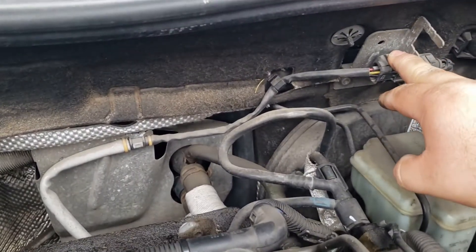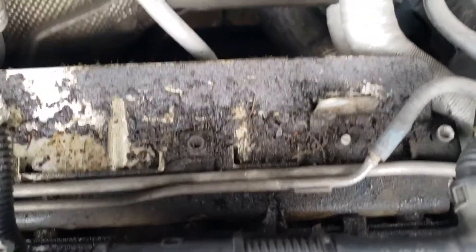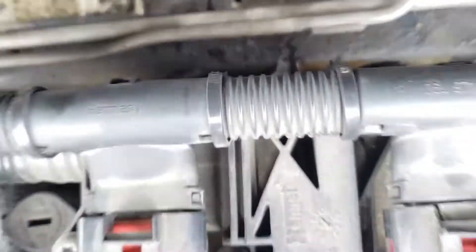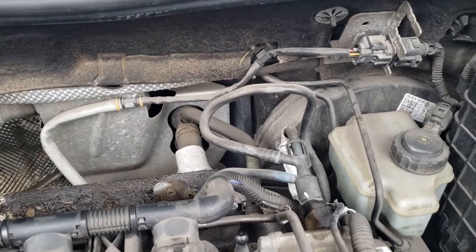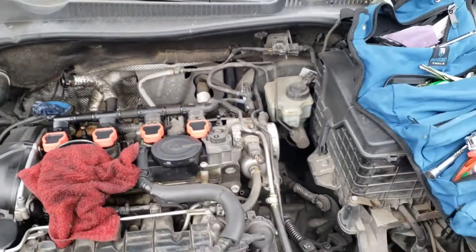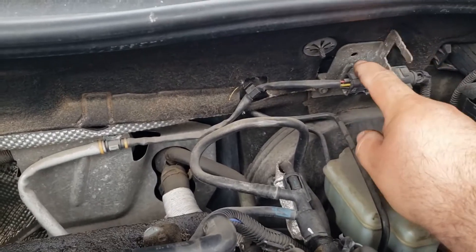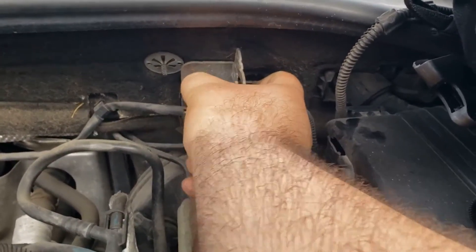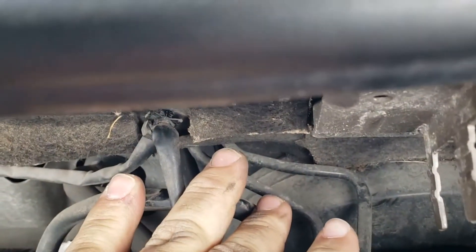You have this clip connector here. The sensor itself is located behind the engine. It's important to note that it is extremely hot and ill-advised to attempt to remove an oxygen sensor with a warm engine. First things first, let's begin by removing this connector. Try not to use any prying tools when dealing with old connectors — it should just slide out depending on how crispy your car is.